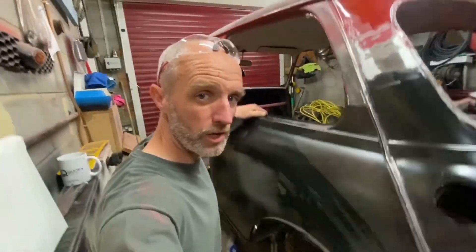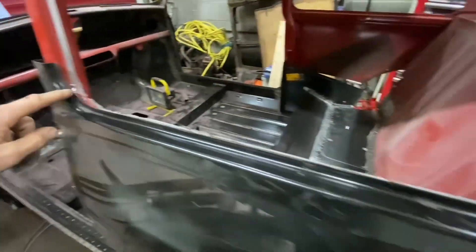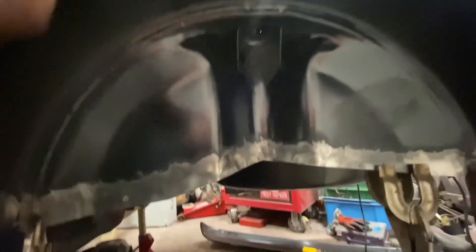First quarter fit — you'll be thinking I'm a long way off the quarter but I think it's relevant to fit the quarter now because I'll lock the gear underneath here, all the arch and that, and the inner panels line up. So I'm putting the quarter on in a rough place just so I can mark across here and across there. The old quarter is just getting in the way of lining everything up. I've got my line down here which lines up with the centre of here — this is all clamped in place. It's got a little bolt there that needs tapping across, bolting in and tapping down. All this needs lining up and the only way I can line all that up is by putting the quarter on and getting rid of the old quarter, so I'm going to cut it off — but not before I've lined these up.